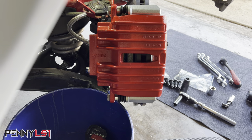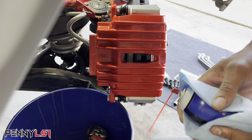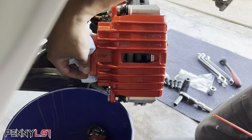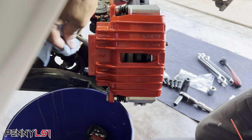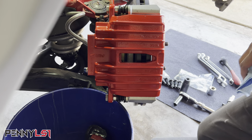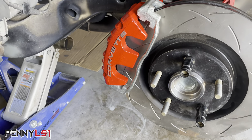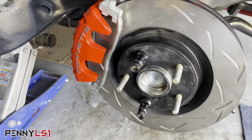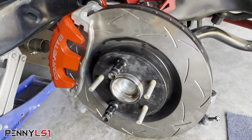I think we got it. As y'all saw, I sprayed some brake cleaner on there because brake fluid will eat through the paint. On the backside of this one it's actually not even painted right where the line goes — it's just aluminum. But I sprayed it on here anyway because I had to repaint my calipers on the blazer ones and they're already peeling again from that brake fluid. There you have it — C5 Corvette 13-inch rotor, two-inch drop spindle, slight modification needed, clear, no clearance issues. The rotor spins, no grinding, no rubbing, no nothing.